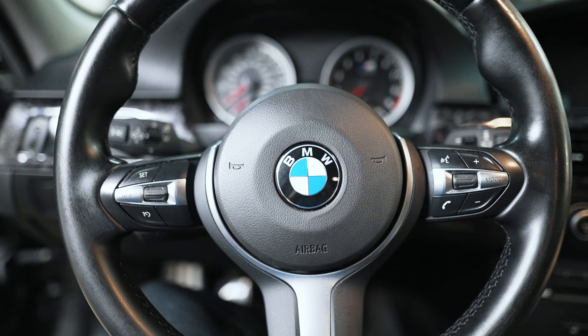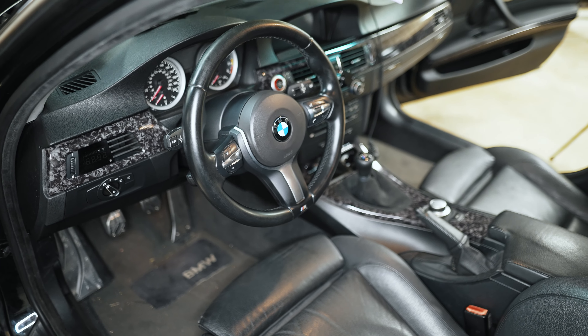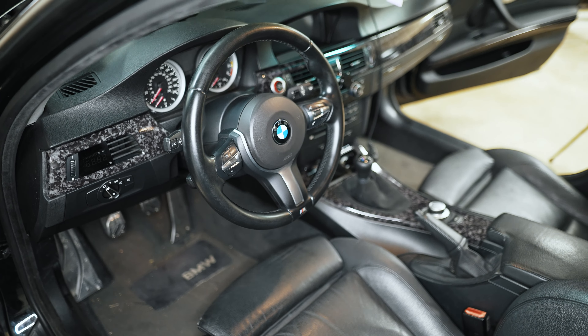One reason this option wasn't very popular is that the ratio felt too light and overly assisted at low speeds, feeling out of character for a BMW of the era. I used to have an '01 330i with very light steering — people complained and BMW made it heavier. People test-driving a BMW with active steering may have found it too light. It's a good bridge between hydraulic and electric power steering, and on the highway a quick lane change or evasive maneuver shows it helps counter-steer to not upset the chassis balance.